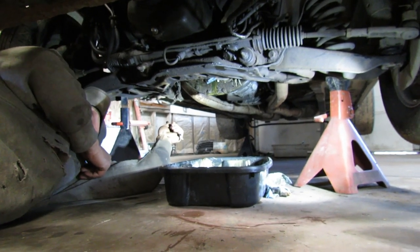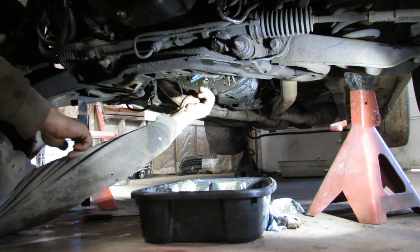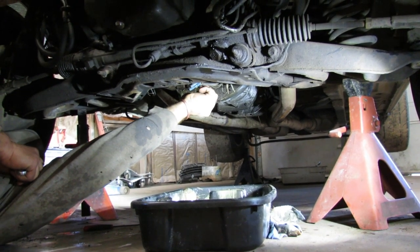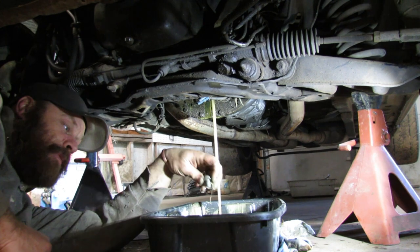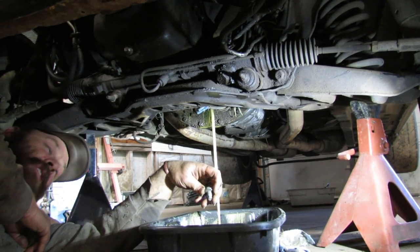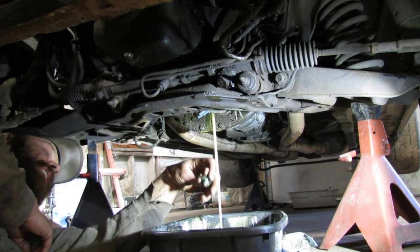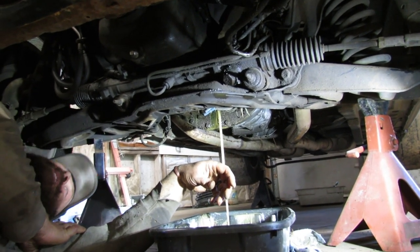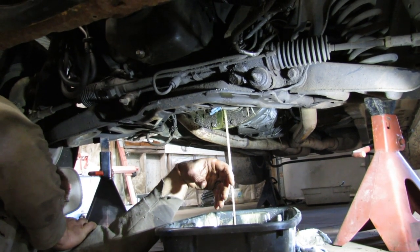I got all the water out — just did the first flush on the oil. There's still more water coming out. I think I pulled out two gallons of water-slash-oil mixture. Apparently my rear main seal is leaking too. Cute.